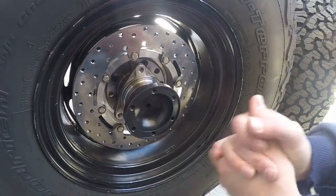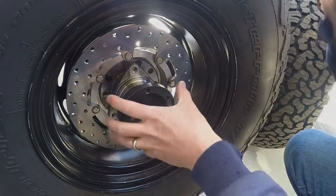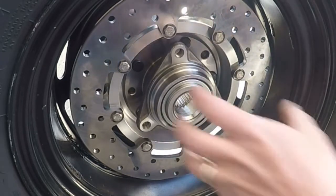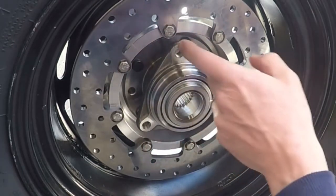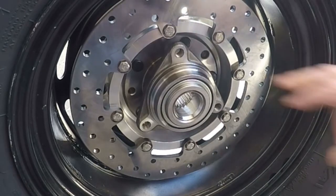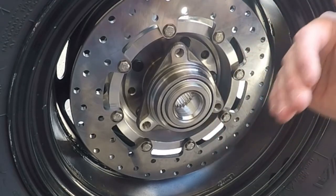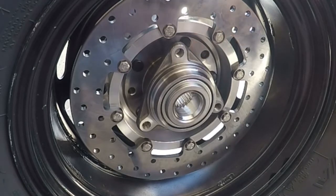The third thing I like — it's not a huge deal, but on the Type 1 you have to weld in the bearing assembly, whereas on the micro stub, this has a bolt flange on it. So you'll build your swing arm, whether tubular or sheet metal, so that the bearing housing bolts into there. If you need to replace this bearing housing, you can do that just by unbolting it. More so for me, since I like to fabricate and try different things, I can build a swing arm that this bolts to, and if I decide I want to change my wheel width or wheelbase length, I can just fabricate another swing arm and bolt this assembly right into the other one. That is really a major advantage.